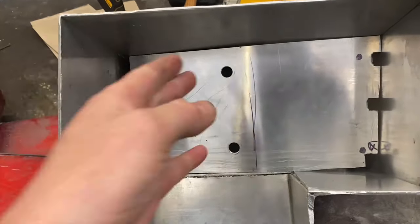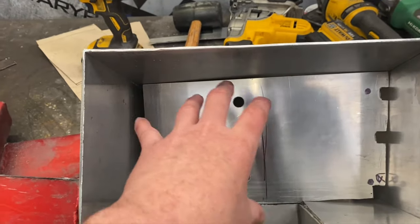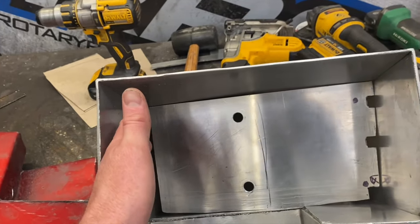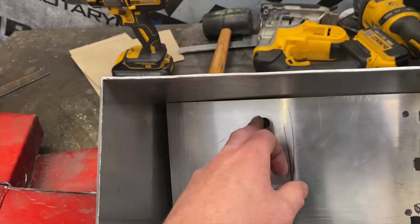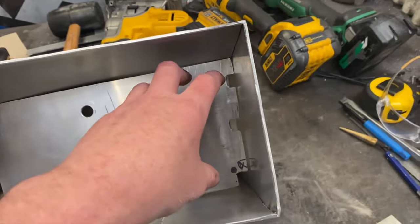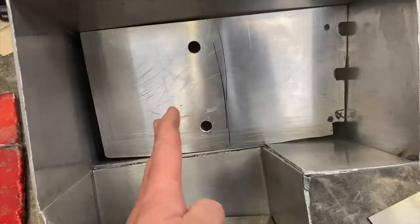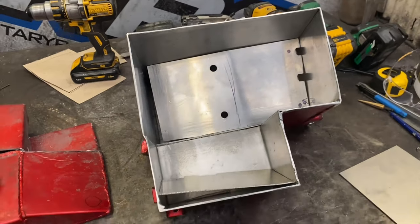The section in here is about another six or so liters contained in this area. So when G-forces push the fuel back, it'll hit a wall and stay in this area. There's drainage here into the lower area, drainage into the lower pocket, and any fuel trapped in the small pocket has drainage back into the main pocket as well, so hopefully that helps solve our fuel issues.